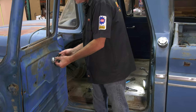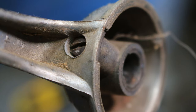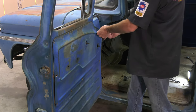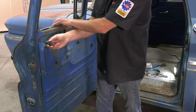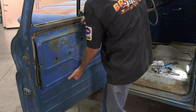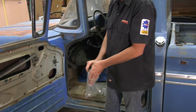Now we're going to go ahead and replace it. Your door handles just go in with a screw that is in the bottom of them. You're going to take those and unscrew them, and then this will go ahead and pull off. When you're doing these, take off all your lower ones first, because a lot of times these are going to be rusted up and they're going to give you trouble. Also, loosen all of them up first. If you get one that is going to give you a real problem and it's all rusted in there, you can go ahead and fight with it when the door panel is still attached.